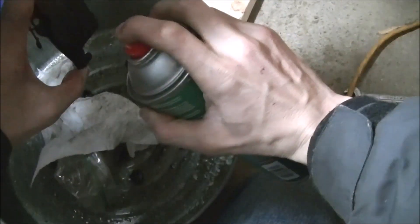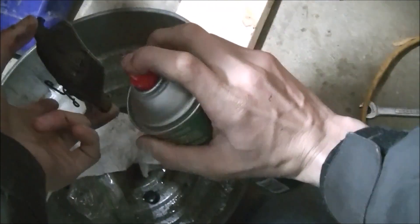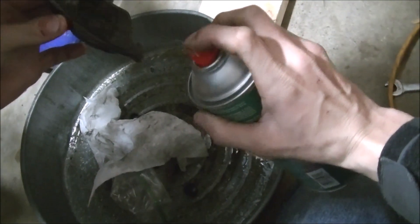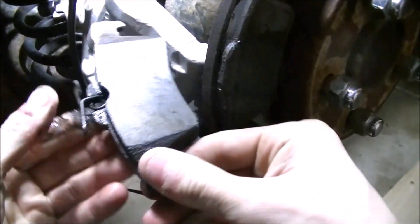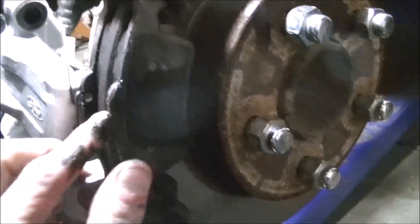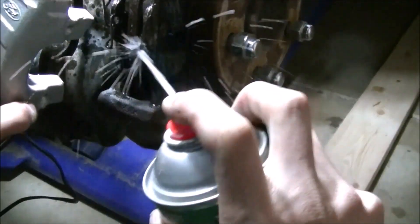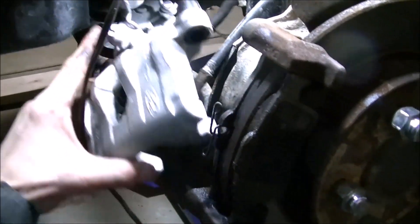For the brake pads, I'm just going to take some brake cleaner and put them back on. I'm just going to stick them back into place. Put those back in place like that. I'm going to drench it more with brake cleaner, trying to dry up as much of the brake fluid as I can. I'm going to stick the caliper back onto the vehicle.